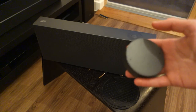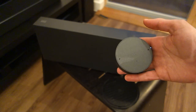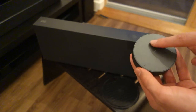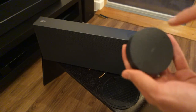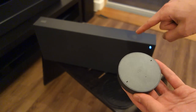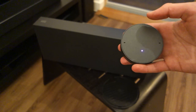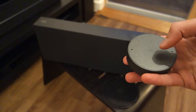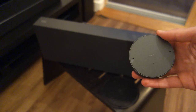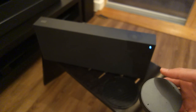In terms of voice, you will need this to be relatively close to you because the microphone is located on the puck, but on the plus side you don't need your phone on you. As long as the phone is in Bluetooth range with the speaker, and this is in Bluetooth range with the main unit, all you need to do is interact with this puck. The voice command goes via this, then via the speaker, then via your phone — all done within an instant with no massive lag. You cannot do voice triggering like 'Hey Google' — you will need to press the puck down for two seconds.